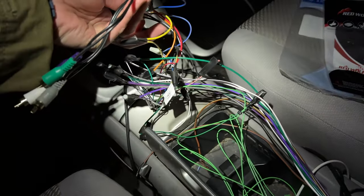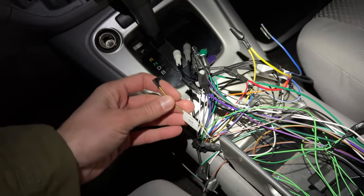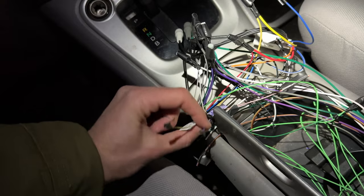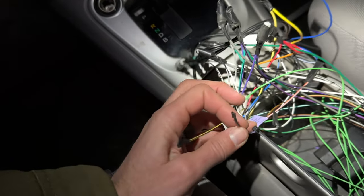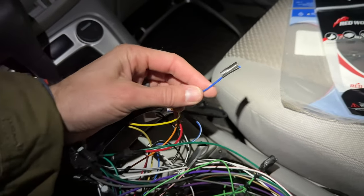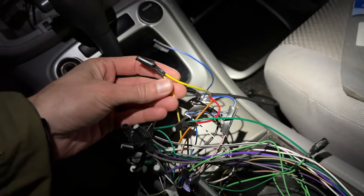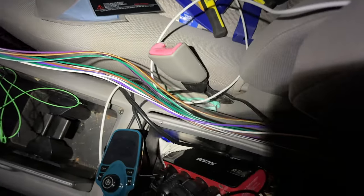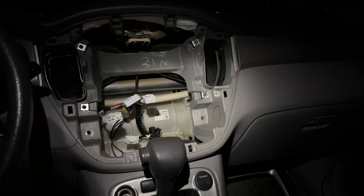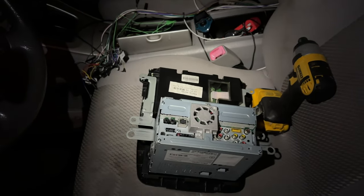I'm not saying you should watch Netflix while driving — if you are, you deserve a ticket. There are some wires you can ignore, such as the mute wire — I just taped it off to be safe. Also the violet with a white stripe — I taped that off because it's for reverse rear signal input, which I don't have. I also taped off the blue wire, which is for a power antenna that I don't have. Pretty much everything else just goes color to color. Everything is linked in the description below, and hopefully this saves you a lot of returns — I went back and forth trying to figure out how this works. The main thing was I didn't realize I had a JBL amp back there.